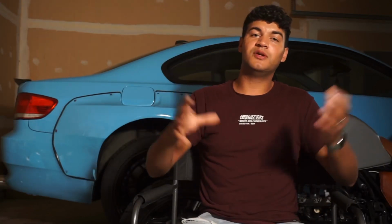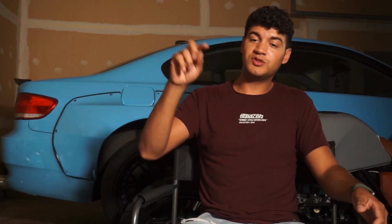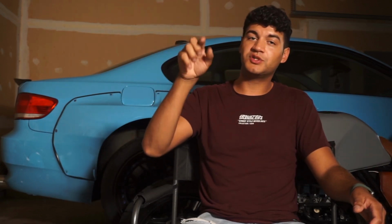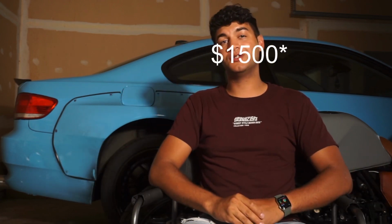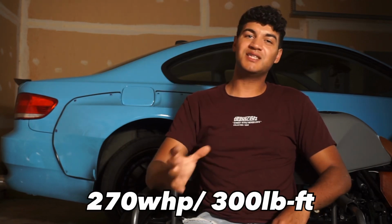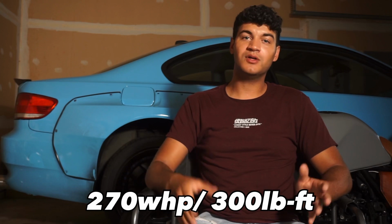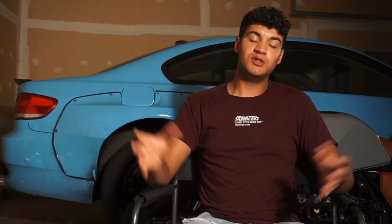But at this point, once you got all this stuff, you can finally just go on your little JB4 app and switch her up to map 2. At that point, you spent about $1,400, and you can go to map 2, and that will give you a little bit more boost. Now with that little bit more boost, you should be around 270-ish wheel horsepower and over 300 foot-pounds of torque. To the wheels, guys. This is to the wheels.